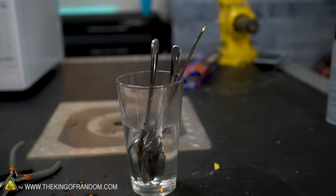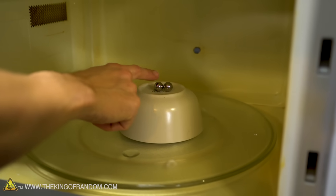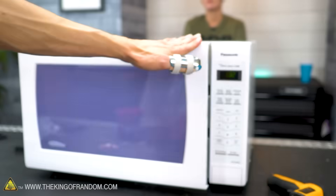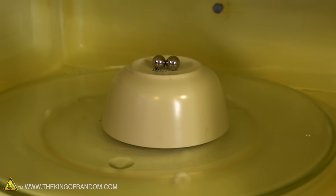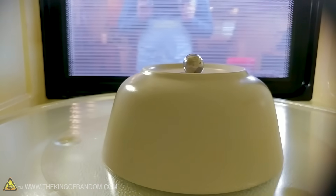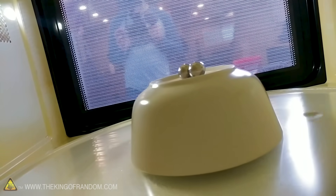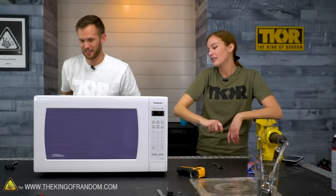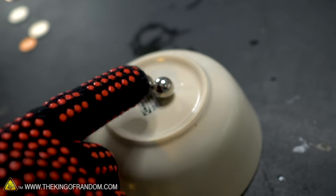That metal has been heated up by the microwave, but not nearly as much as — not even necessarily explosive, but more energetic than the reaction I was expecting. I've now put a couple of ball bearings on our upside-down bowl — these are steel five-eighths inch bearings. In theory, because they're really round and smooth, they should just have a single contact point — extraordinarily small — and that seems to be what was working with the forks and knives getting them to spark. I'm curious to see if the ball bearings will spark. The phone is freaking out a bit. The back wall of the microwave is getting hot to the touch — that's why I'm feeling the top, making sure we're not getting into a dangerous range. To touch anything — I don't really see anything on the bearings. They might just be too small to get hit by much.